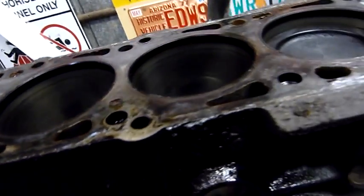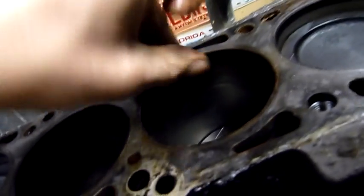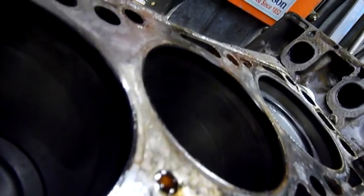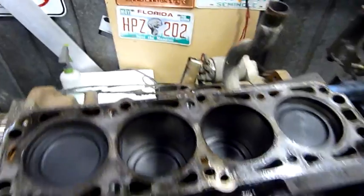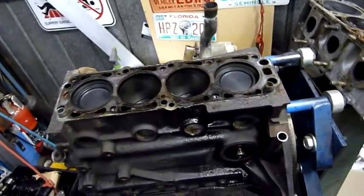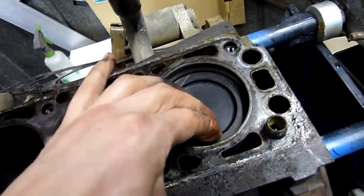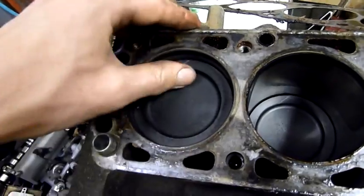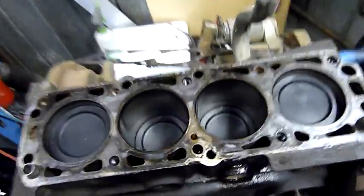Overall the cylinder walls aren't too bad - there isn't even really much of a step in them. There is no step - you can still see all the honing marks in the bores. The pistons themselves and the big ends will be the real telltale - they'll tell the tale of what really happened to this engine. You get a bit of noise and movement normally, but I'll bet all the noise when that engine was detonating was these pistons smacking into the sides of the bores. Again, that doesn't look too bad - I'll have to turn it over. I think we'll worry about that tomorrow.